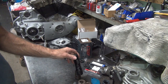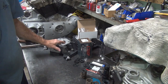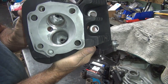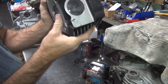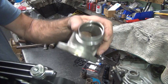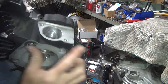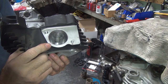We're getting ready to assemble these Sportster heads. These are Evo 1200 Sportster heads, 90s style. These are the ones I did all the porting on. We opened up the exhaust port and the intake port to match the big S&S intake manifold. We port matched them because the S&S manifold was way bigger than what the port was before - we had a big wall we were hitting against. So we went ahead and opened it up to the full size port.